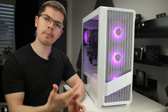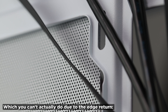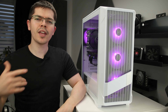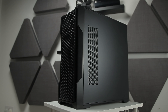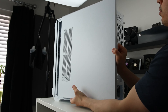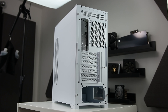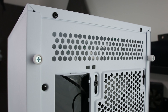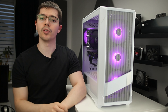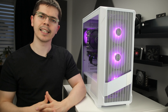The front looks great to me and I think it'll have some wider appeal. This 3D-ish mesh will actually increase the free area for the intake, which is great - similar to what you get on car intake filters. I'm not 100% sure whether this is a previously used review sample or brand new, since removing the front panel was so much easier than the AX90, but the clips look heavily used - colour me sceptical. There's no extra filter to the front, not that it's really needed, as the damaged filter seen earlier is actually for the side panel intake.